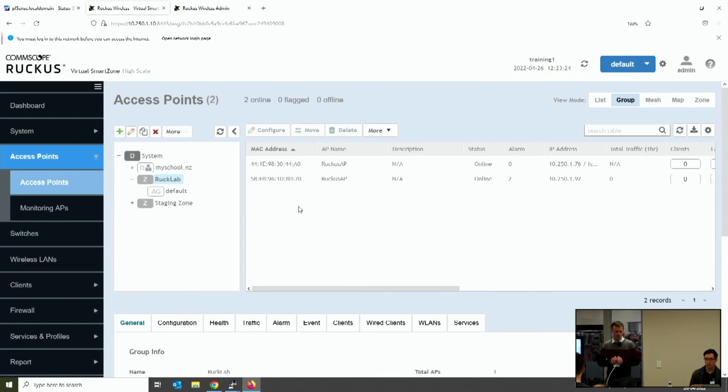Just a question on that, a little bit aside. On the old zone director, Wi-Fi isolation was per AP. On the new SmartZone, it seems to be per SSID. Yeah, correct. I think it's both, though it might have changed. Originally on the SmartZone, we had 2 tick boxes. One said isolate on the same AP, and another said isolate for the entire network. But I think we may have done away with the isolate on the individual AP. Okay. But you're right, it is per wireless network now. Excellent.